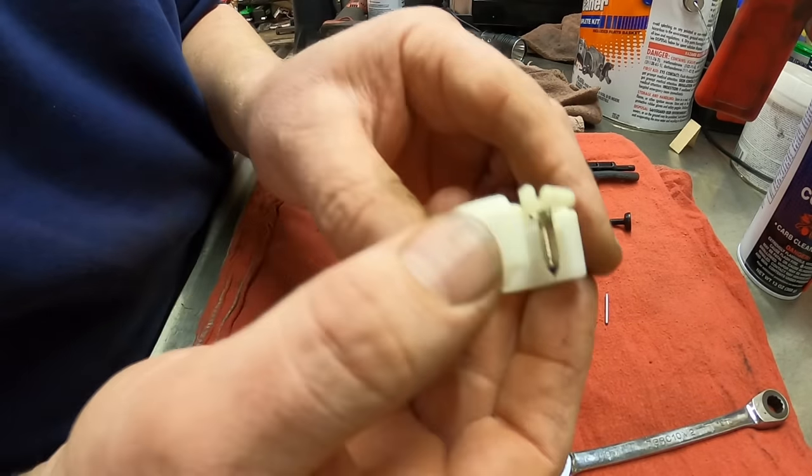All right, so here we go. Throttle on full. Choke on full. We'll hit the primer bulb like three times. Okay, maybe three more. A little too close to the building. I can smell the gas now. I guess I didn't need to choke it, so let's go ahead and put it back on rabbit, no choke.